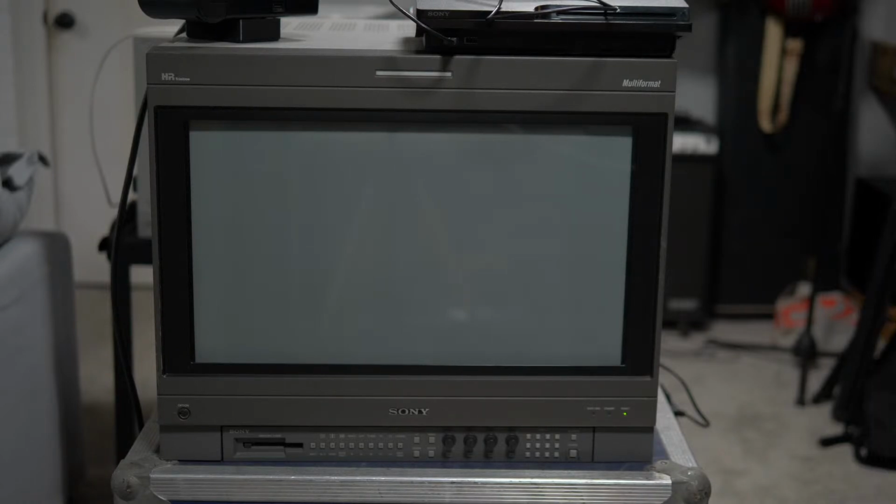SDL676 once used a Mitsubishi presentation monitor that could take high-resolution PC inputs, but couldn't take 480p. Yeah, very, very common. A lot of those wouldn't be able to do that. And some had different inputs that could support different resolutions. I have a couple of monitors that don't support 720p, but they do support 480p and 480i. I have another monitor that wouldn't support 480i over the HD input. It's kind of weird, but that's pretty common to see.